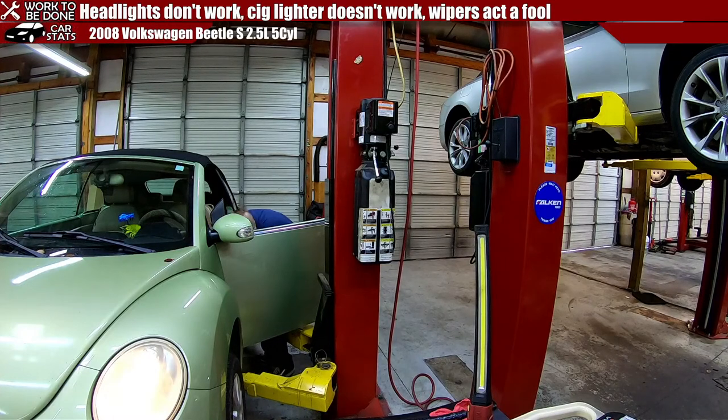It's hard to tell. Is the fuse still good? Yep, fuse is still good. Also confirms that I have a reasonable setup here with my ground, but I need to get closer to it. Yep. Got it. Bless it. Okay, cool. I didn't short it. I thought I blew the fuse. Yep, that one works. I think their charger here is dead. It's got a little LED on it, but it doesn't work. Their charger's broke. I'm just trying to check these. Yep, both 12 volt sockets work. Excellent. So that's that part.